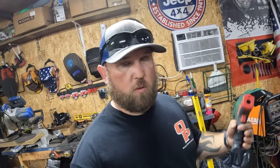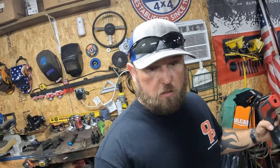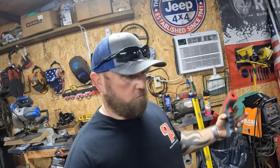So when you weld to cast, you have to heat the cast up to somewhere between like 300 degrees and 500 degrees Fahrenheit. So I usually heat it up to right about 350, 400, somewhere in that general area. It usually works out pretty good. And once you finish welding the whole thing, it is going to be hot. So once you finish it, you wrap it in a blanket, you know, a fire resistant blanket, a welding blanket or something. That way it keeps that heat locked in there and let it just cool down as slow as possible, and you shouldn't have any cracking. So I'm gonna show you what the cast reads right now, and then before I start welding on it, I'll show you what it reads again.